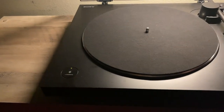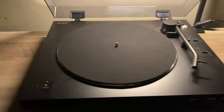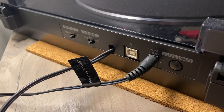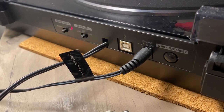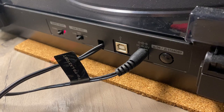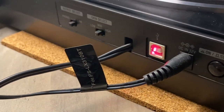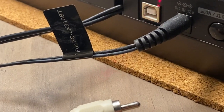This is a fairly good turntable here — this Sony model. It's the Bluetooth model, so it gives you the opportunity to do some Bluetooth as well — very flexible. It's also automatic. Now let's take a look at the back. As you'll see, you have an output select: phono and line. This is very important because the phono output is a much lower level that requires a preamp, where the line output can be used to plug directly into an amplifier. There's also a USB on this one, so you can USB out just like we'll do with the Project preamp. We will not be testing this one today.